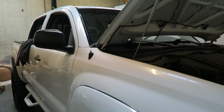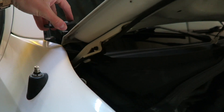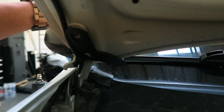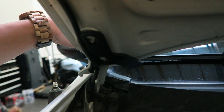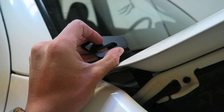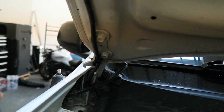Mounting the ditch lights is actually really easy — all it is is just two bolts. We have the bracket right here and it's gonna go right where these bolts are. We'll just take off one bolt at a time, replace it with the mount, and then the LED pods mount onto here using the extender bracket to fit both pods. The reason we do one bolt at a time is because there's a track up in here, and if you take both bolts out at the same time it's going to be a lot harder to get that track back in place. There are just two 12-millimeter bolts — take off one at a time and replace it as you mount the bracket.